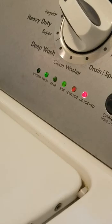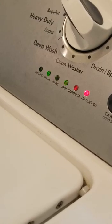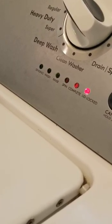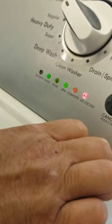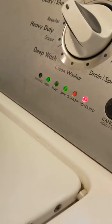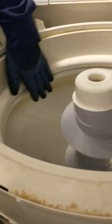I'll show you a few of these. The first few are just water valves — blank, then clockwise one notch: that's a water valve. I don't want to run any water until I get to spin, so I'll skip those. That one's also a water valve; a lot of them are. That one's not even used. The next one that's used is the drain pump, so that would be your drain. There's no water in there, so we're going to run it now.